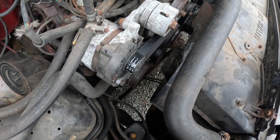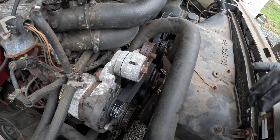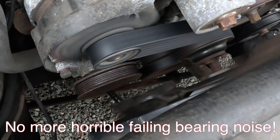The 78-inch belt is perfect — that eliminates the smog pump itself and it looks like it's routed in the right directions. The shorter belt allowed me to eliminate the smog pump from the serpentine belt circuit without having to do anything else. It was a bit expensive at $75, but I didn't have time to order from Rock Auto — that would have been probably $12 but then $35 shipping, so six of one, half dozen the other.